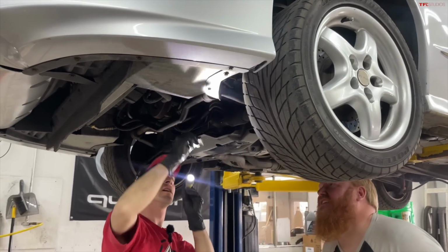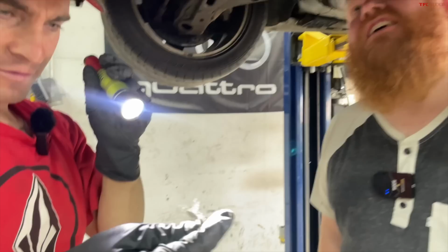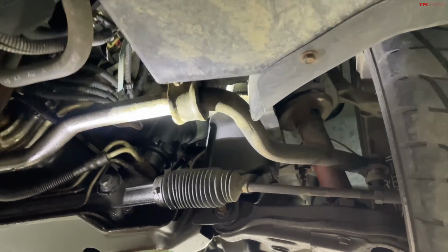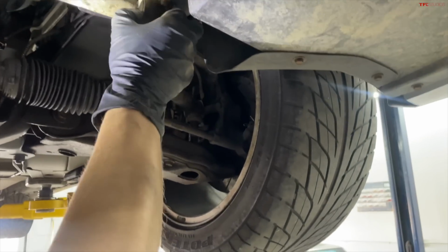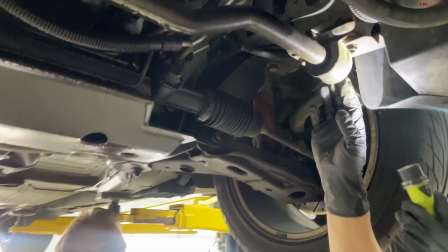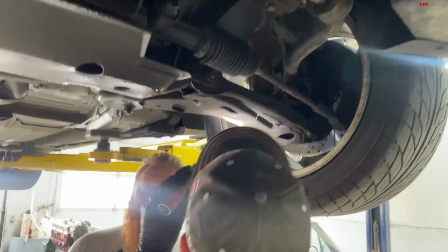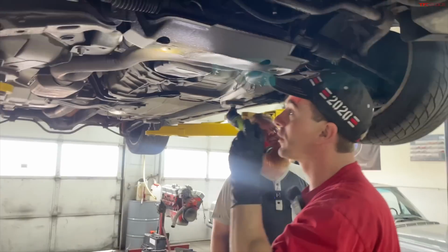Huh. What? Looks like somebody's hair? I don't know. That was some kind of fiber of some sort that was wedged in between the sway bar bracketry. That's kind of fishy. Are these pretty dried out too? Oh, I'm sure they don't look fresh, but they're not split and cracked. That's usually what I'll see first, just big splits and cracks in the rubber. And same with the control arm bushings and all that stuff. Okay. Usually I just take a quick peek at it all, and then that'll tell you how dried out everything is. You'll know pretty quick.